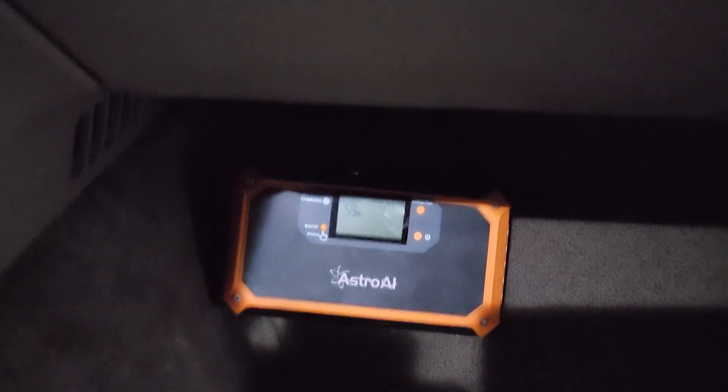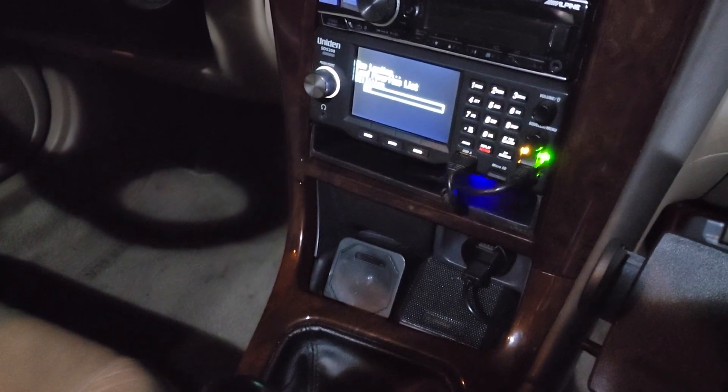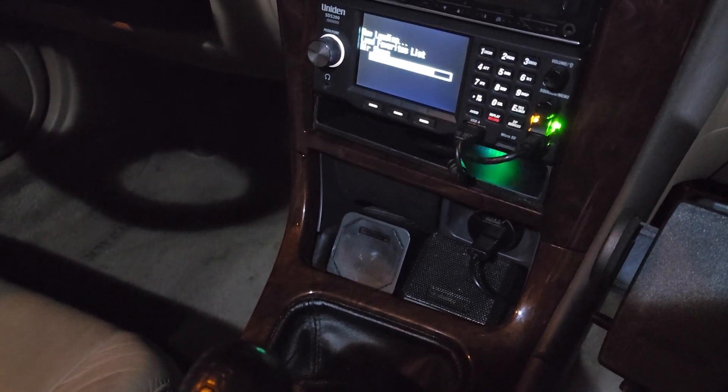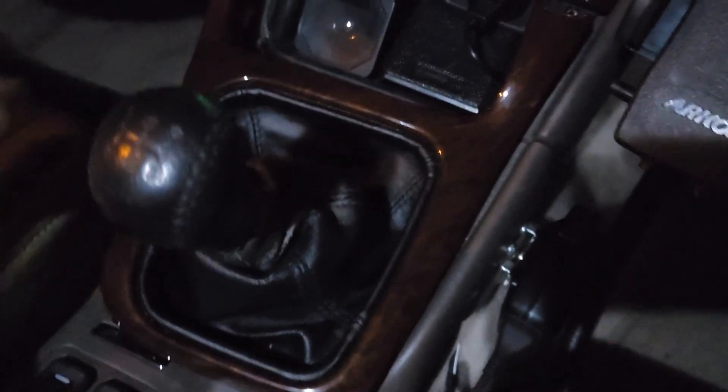One last mod I did. In my last video about the SDS, I talked about pre-wiring an RJ-11 connector with the intent of eventually adding a GPS. Here is my shifter — if I carefully pull the molding up and move this aside, you can see a little GPS module hidden in here. You can see an RJ-11 connector. This is a Neo 7M — I'll have a link in the description — it was about $11 on Amazon. You can either solder the connector onto it or use female pin headers like I did here.